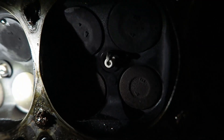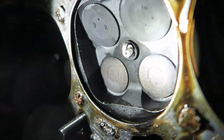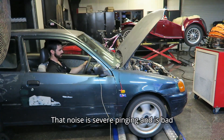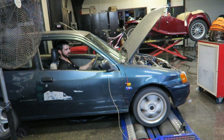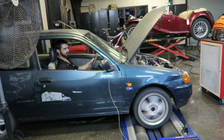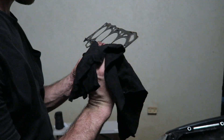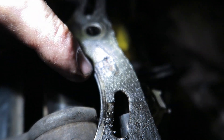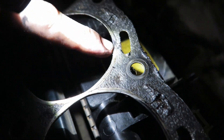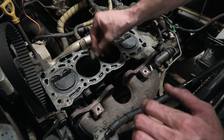Look at that — a melted spark plug is not good. I'd say this happened when we were messing around on the dyno. I put the nitrous kit on myself and forgot to check the timing, so when I asked Keelan to do the power run, he ran the car up based on what I'd set it at — and this is why it made those horrible noises. It's blown across there; you can even see the material where the head gasket has gone.